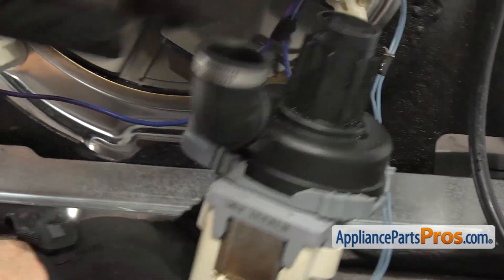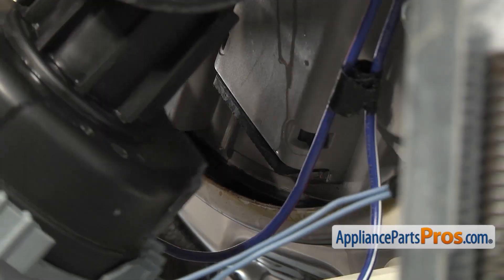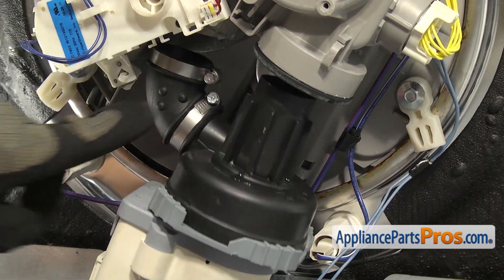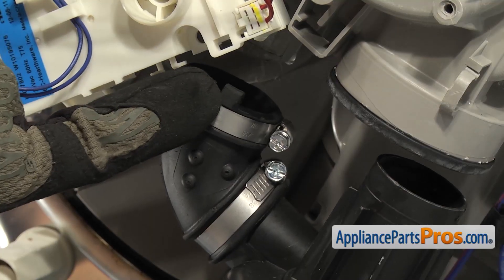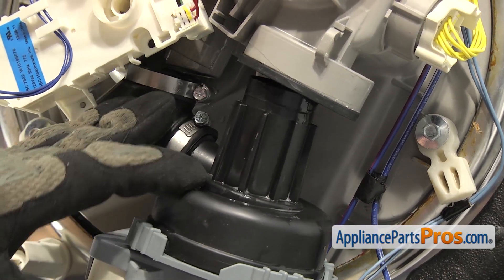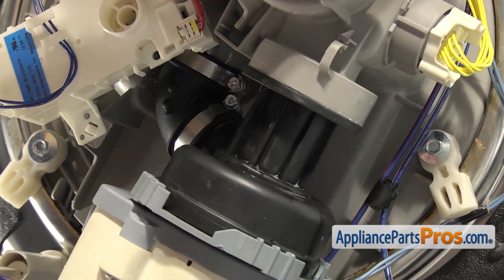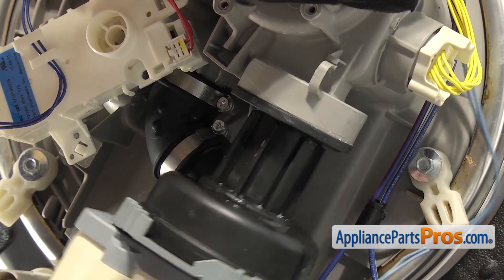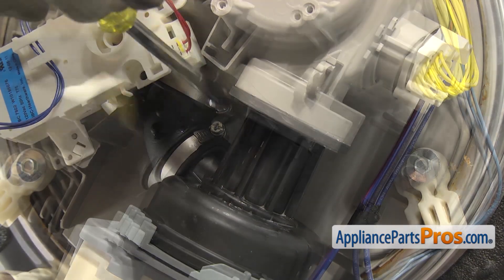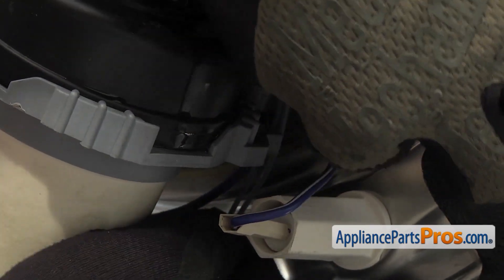To put the pump in, we're going to lift it back into place. Make sure that this tab goes up into the little mounting grommet. Once you have it in there, carefully lift up on the pump, making sure it goes up into the seal. As you're pushing up, you're going to have to push this hose over a little bit to make sure the hose goes on and the tab goes into its little cutout. Same as when you push the seal in, get all these fittings wet to make it easier to slide everything in. Once you're ready, lift it up into place. Once it's seated properly, use the quarter inch nut driver to tighten down the hose clamp. Once you have the clamp tightened down, put the wires back in the retainer — just grab them and clip them back in.